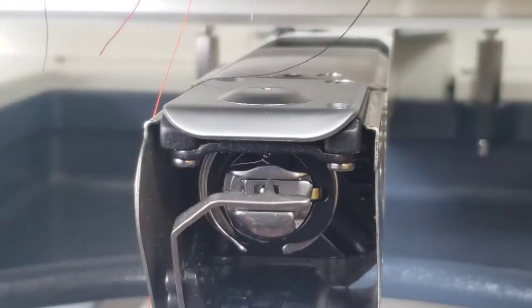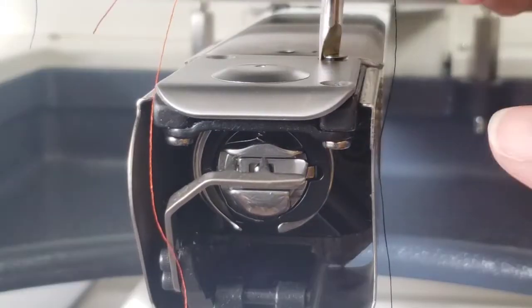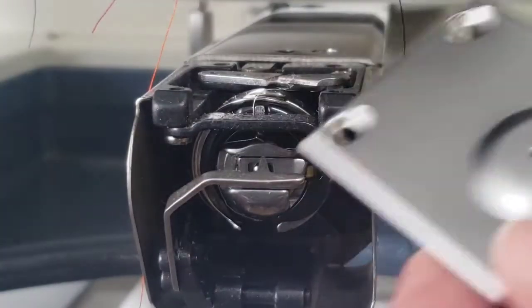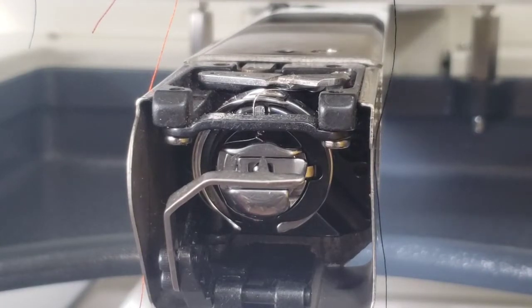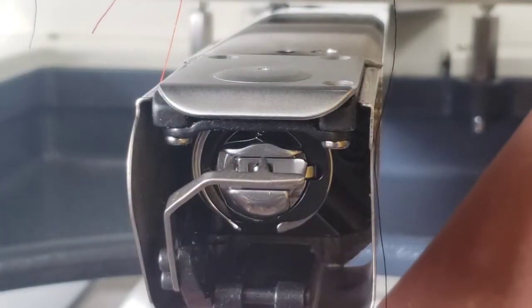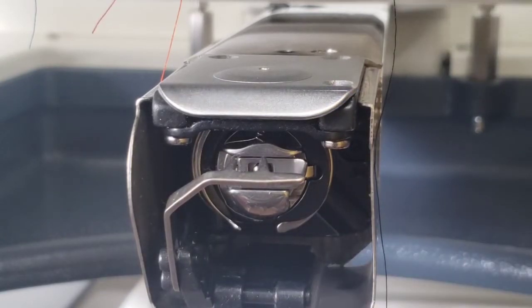Be sure to not lose those little screws because you use the same screws to put the other needle plate on. So you remove that part onto the screw and remove that needle plate, and you want to install the next one the same way. There are three screws — the smallest screw goes in the front hole.